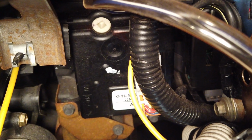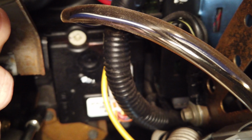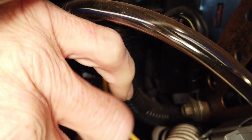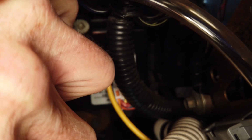Now we're going to just take and work on the one right down below where we were working. This one partially holds this metal bracket that's over a vacuum actuator, but that's irrelevant. But just when we go to put it back in, we'll have to line it back up, and just same deal, turning it out. None of them seem like they really want to turn out easy, just to mess with you working down in this tight area, reaching down in where the radio, and even down to the extension in the socket, and we're just going to try that since it's starting to turn free.